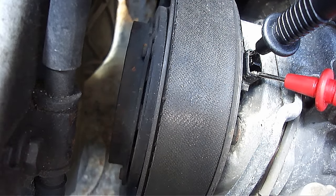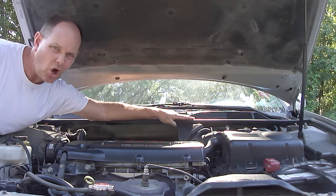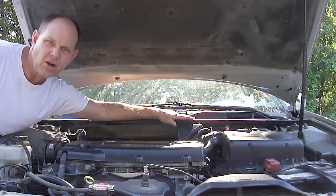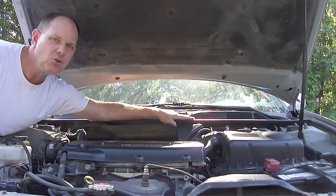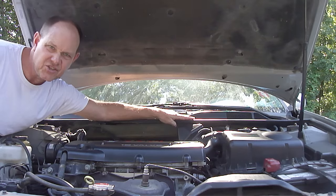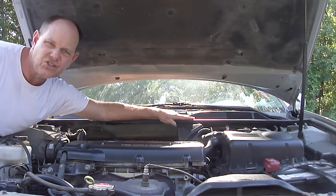This clutch is good. Another big caveat is sometimes it's just as cost effective to replace the entire compressor as it is to replace just the clutch system. If you do replace just the clutch system, this can usually be performed without having to remove the refrigerant lines on the compressor.